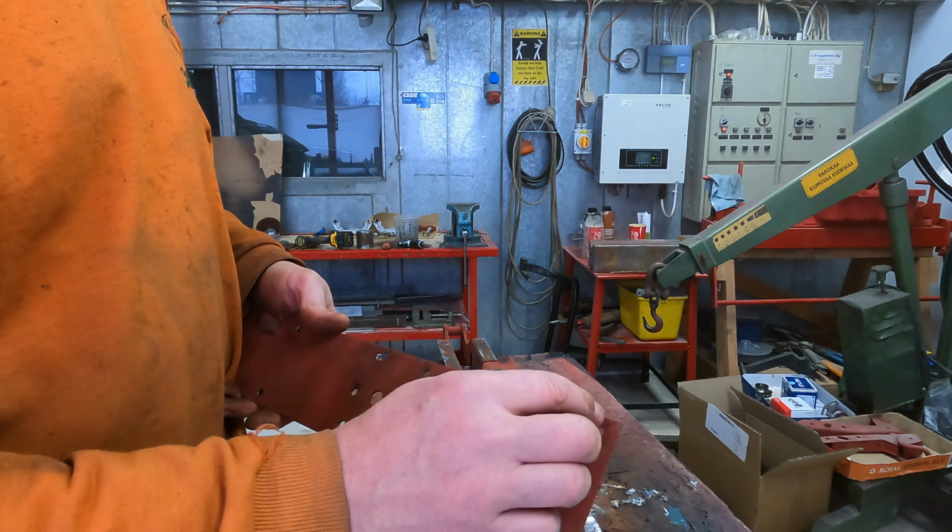This cross member, rear differential carriage beam, I don't know what this name is, but it's quite rusty like the previous one. I'm going to open this one too and clean the rust off there and weld it back. These bushings, actually in the Volkswagen catalog, I cannot find the part number for these. There is a part number for this whole piece, but it's not available anymore. So I'm going to change these bushings because you see how torn it is.